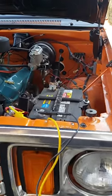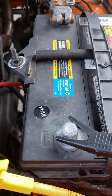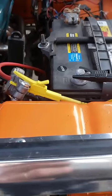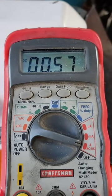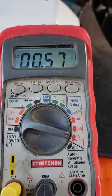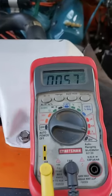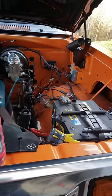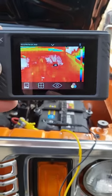To my tin grill buddies - I noticed my battery keeps dying quickly. It's an 11 of 18, so about three years old, cheap battery probably. I'm doing a quick current measurement using a regular multimeter and I have about 570 milliamps - that's a huge number. The most you want is around 30 milliamps to keep a battery from going dead. I'm also using a thermal imaging camera as a specialty tool here.